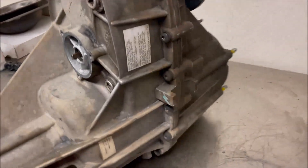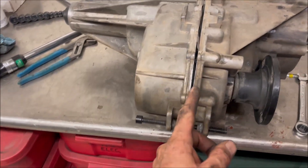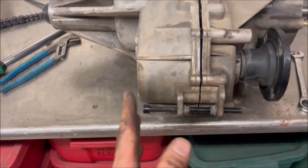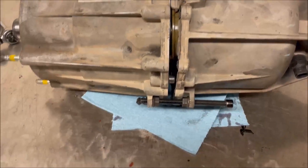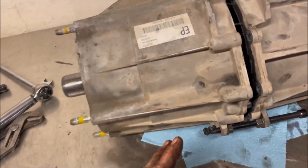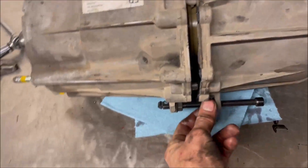This will not have a snubber inside it either — that was added later. I didn't show this in the last video, but here you can see I'm using the case spreader bolts on these ears. As you slowly tighten these two nuts on this piece of all-thread, you can see it pulls the case apart and breaks the factory RTV sealant. This allows the case halves to come apart parallel so you're not bending or breaking anything, because the shifter rod right here is a pretty delicate piece that you can break if you start hammering and prying. You definitely want some rags and towels standing by — there will be residual fluid that comes out because the drain plug doesn't fully drain the case. So when you crack it apart, get ready — there will be a puddle. You can already look in there and see the plastic shift fork.